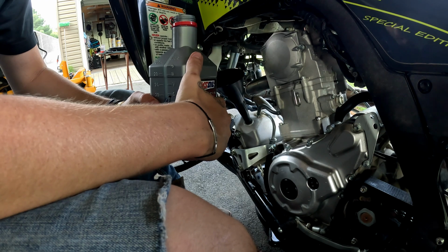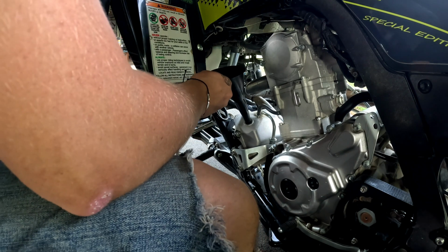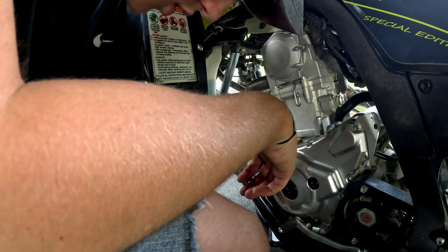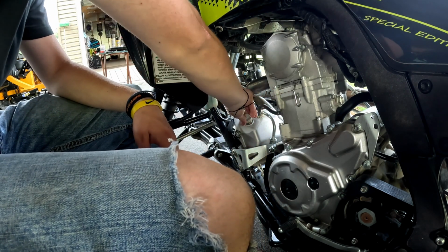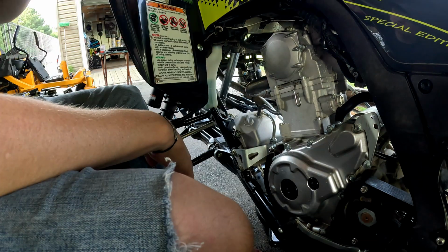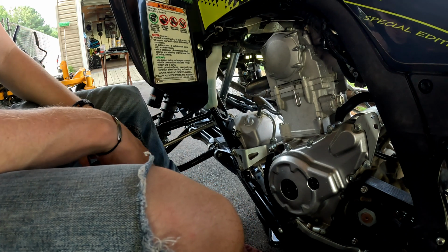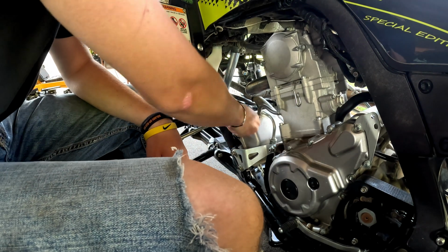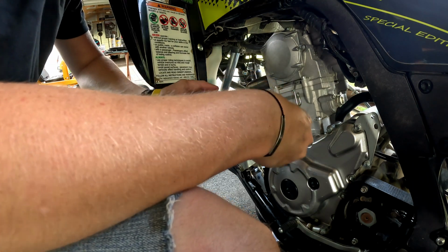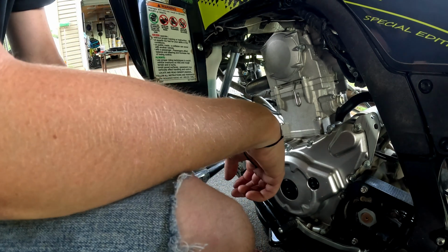Okay, so that is about 0.4 quarts, which is fine. Let that flow out of the filter or the funnel. Like I said, plug it back up, and yeah, I'll start the bike for anywhere from 5 to about 15 seconds. Alright, so that was 10 seconds of running. Now I'll take this back out. So we're at just above the E, which is just about where we want to be, I'd say.